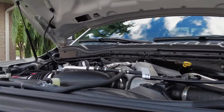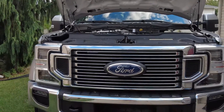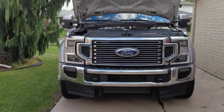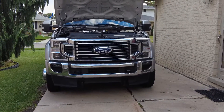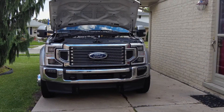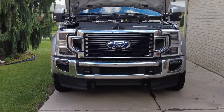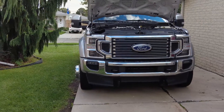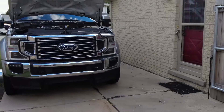We covered the DPF and the fuel filters. The oil change itself is about the same amount of work just to change the oil. The fuel filters need to be done every other oil change, which adds a lot more work and money to the job. The actual oil change itself isn't really harder, but it is more expensive because the diesel oil costs more. You need 13 quarts versus just 7 quarts — almost double the capacity of a gasoline engine.